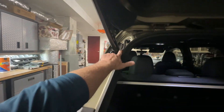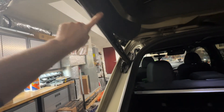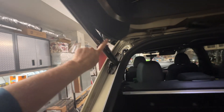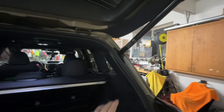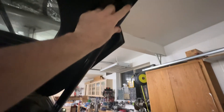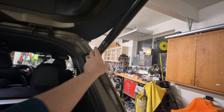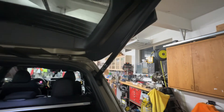So what I'm going to do — this is the lift actuator, located here on the driver's side. It's really important to recognize that this is the one that is going to be actuated by the electronic lever in the back and your remote. This one is actually a mechanical lift strut. There are no electronics at all, so I'm going to replace this one with a stronger 200-pound unit.